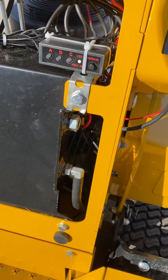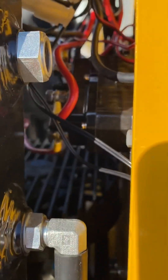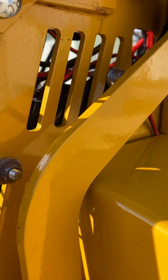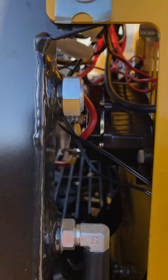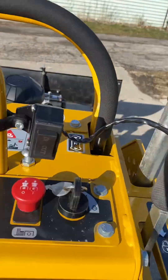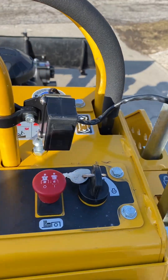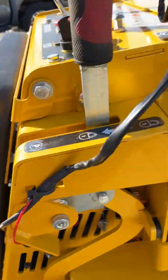You can make it go up and down, and I put the solenoid for the winches inside there. It just bolts to the side, goes right down to the battery box. It's pretty easy wiring with the clamp right here for up and down — it just runs around and goes down through this big hole.